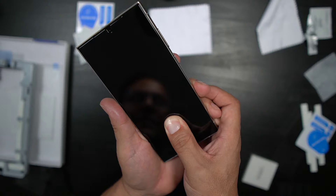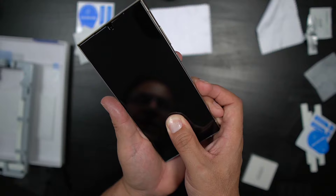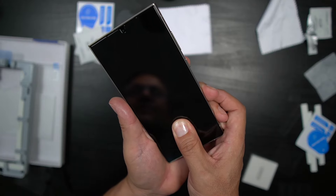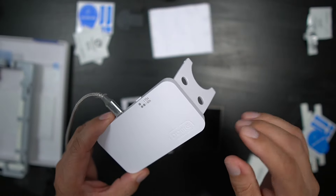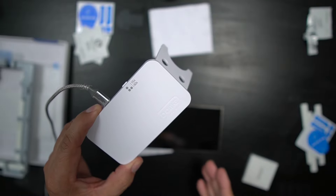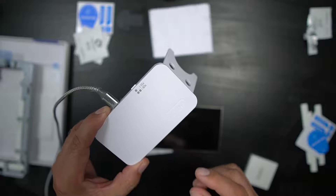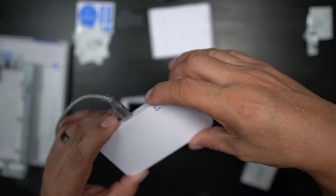Here's a tip: push down on the middle where the fingerprint sensor is — about a finger and a half up from the bottom — and hold that down for about 30 seconds. White Stone Dome gives you the little white weight, but holding your finger there for about 30 seconds helps make sure the fingerprint gets the proper response when you set it up. Then take your UV light again and do 60 seconds to the top and bottom — do it twice. To get 60 seconds, double-tap the button.